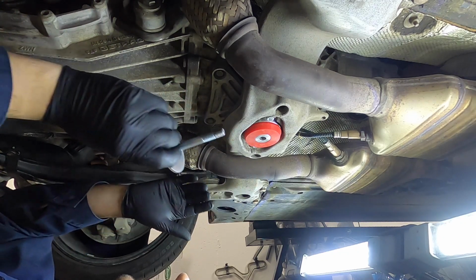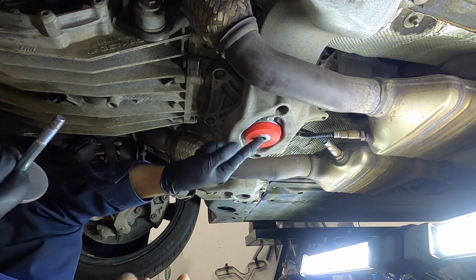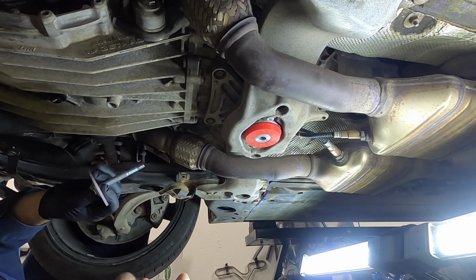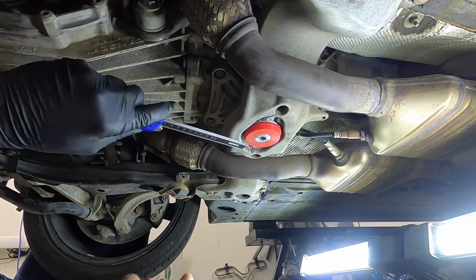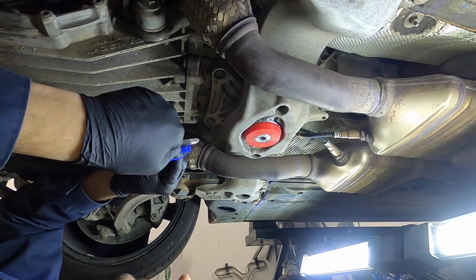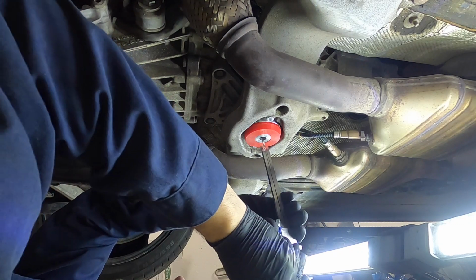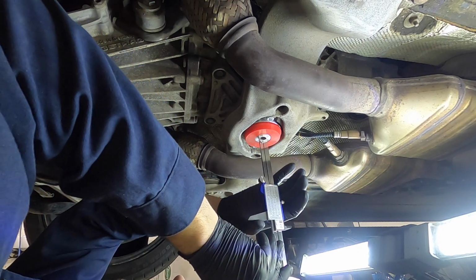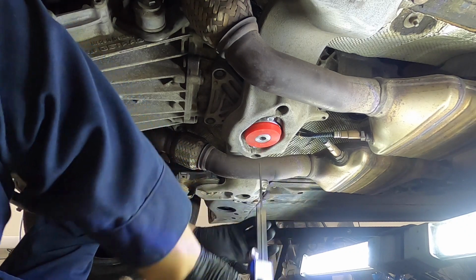Now obviously it wasn't leaking, and I've already looked up here with my flashlight and I can tell that there hasn't been contact, but just one time for the record here, what I want to do is take my digital caliper and measure what my total distance is, my safe distance, and then let's just see how much we're actually using. So I will use the extension part of this, put it at my lowest point, send it up, and I've hit the bottom of the transmission.